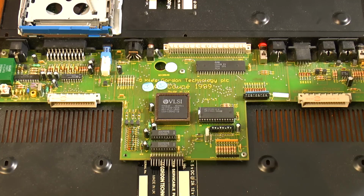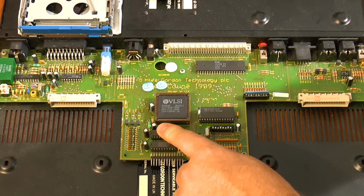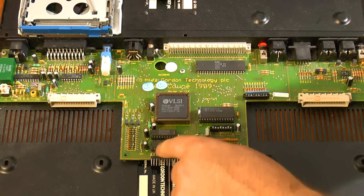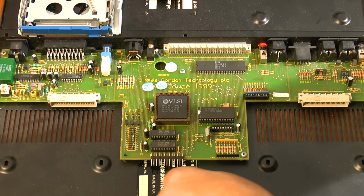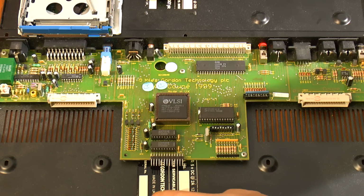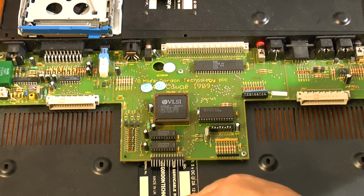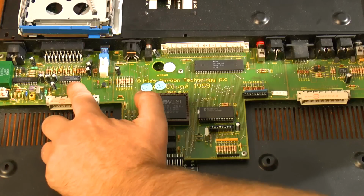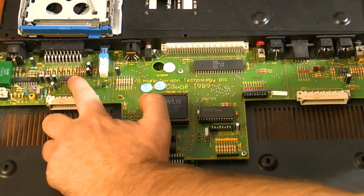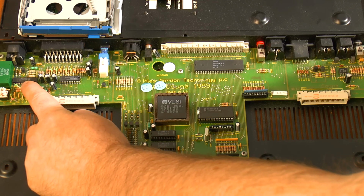We've got two Siemens HYB514256A chips. I think they're 4-bit chips. So you have the two together to give you an 8-bit memory. There's the port then for expansion, and notice the serial number sticker from the bottom is actually double-sided. It's printed on both sides. Just one side's adhesive. Going up further over to the side, then we have a Philips SAA1099, which is a 6-channel sound chip, and we have an MC1377P, which is an RGB to PAL or NTSC encoder.